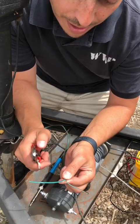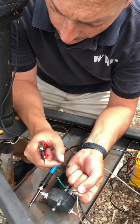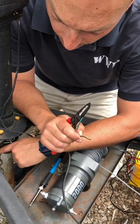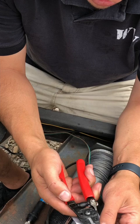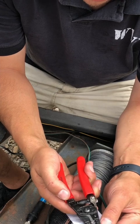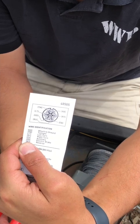This harness itself has writing on it. The green is our right turn, the brown is our taillight. That means the yellow is going to be our left turn and the brown is going to be our taillight going the opposite direction. I don't have reverse lights on this and I don't have an electric brake — BU, EB — those are not going to apply to me.